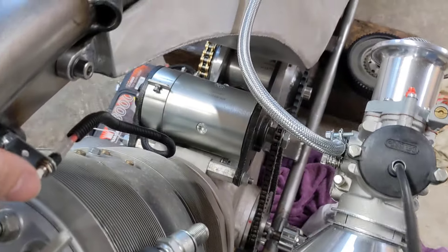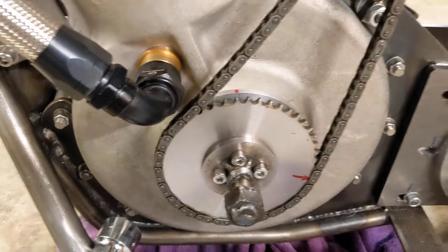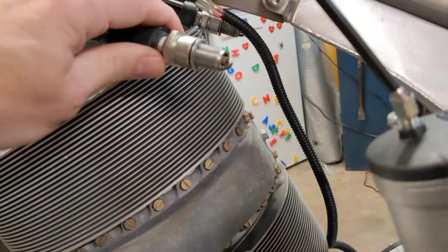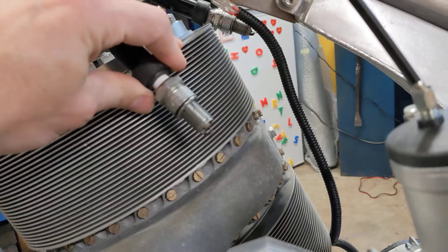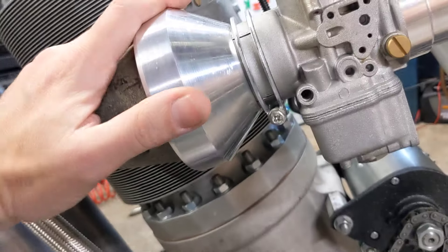So when I kick the bike and press the button at the same time it does go over the top. I'm not quite sure you'll be able to see this, but here we go. Yeah, no problem at all — that's gone all the way over the top. What we do get is a nice big fat spark when the ignition is energised, but we've got absolutely zero response from the engine itself.